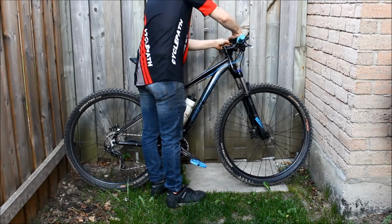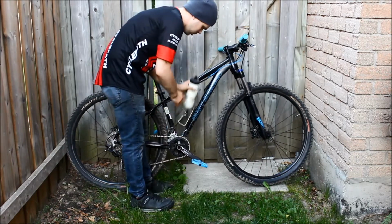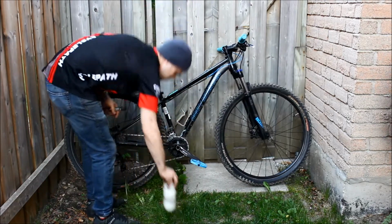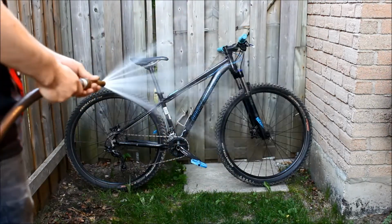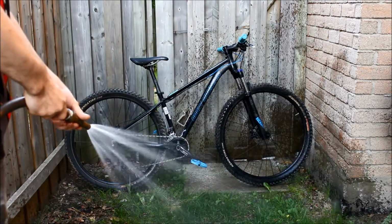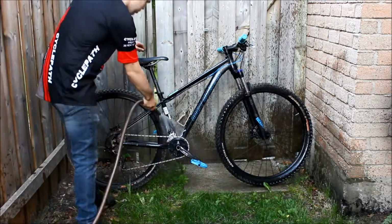To answer a frequently asked question, no, you should not power wash your bike. Yes, the pros do it, but they go through multiple bikes a year and they have sponsors to pay for replacements. Power washing makes bikes look good, but it forces water into places that shouldn't have water, and that water can displace necessary grease and cause horrible corrosion inside of the bike.